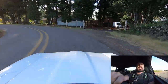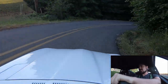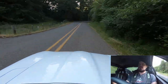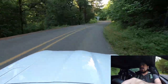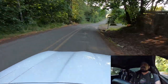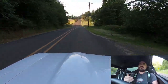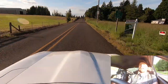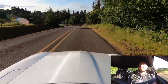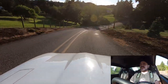One of the best things about this car so far: the suspension is super predictable. I'm really liking the TechnoToy Tuning coilovers — very predictable, very flat, but not harsh and aggressively sprung. I'm getting very good road contact even on this bad surface. But the tune definitely needs some work. Partial tip-in and tip-in where you'd be doing most of your street driving — not so great. It's got some breakup and strangeness to it. It's tuned a little more for safety, so it's probably tipping in a little rich, but I don't want to be beating on this thing right now. I just want to make sure everything's broken in so I can do an oil change before we go to the dyno.